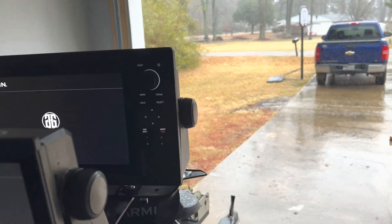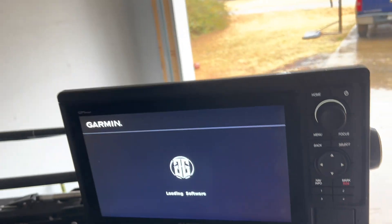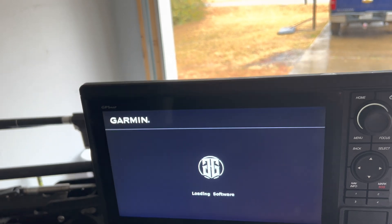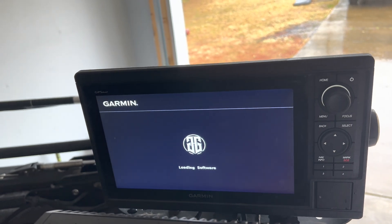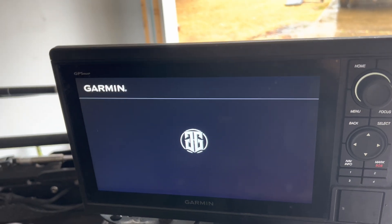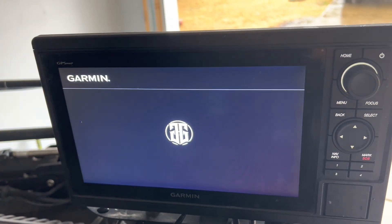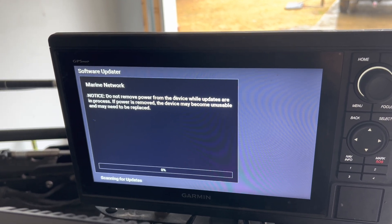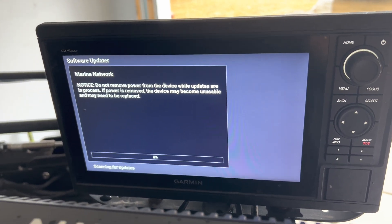I'm not going to take it off until it says 'holding boot block.' All right, I let off. On the back it says 'starting recovery update.' I'm not going to touch it. It will update this one first and then update the second one — the GPS map — then Ethernet into the second unit. It has left the screen now and it is loading the software from the card I've installed. I just want to show you what pops up next.